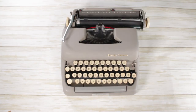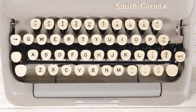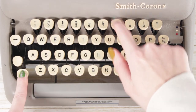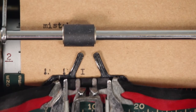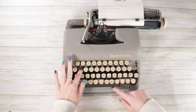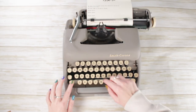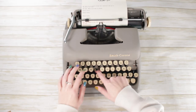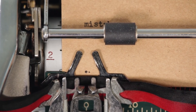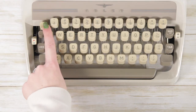There are also a few cool typing tricks. Your number row keys should have symbols across the top — just like on your computer, you can hold down shift and use them. You might notice that the apostrophe is above the eight on your typewriter, so to type a word with an apostrophe you'll have to use shift and the eight. Also, most machines pre-1960s don't have a one key — to type one you will actually just use the lowercase L. And no one key means no exclamation point. To make an exclamation point, just type a period, hit backspace, and then add the apostrophe which is shift-eight. There are machines that have one keys with exclamation points — they just might be of a newer vintage.